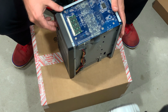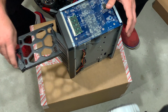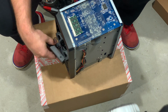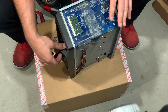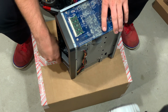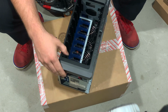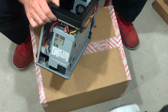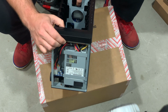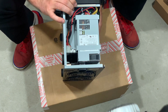What they don't tell you on the spec is that inside of the box here, there's another SODIMM slot that you can easily access. So if you look right in here, there's a slot right there, and right now it is, how much is in there? This is the 2 gigs of RAM in here. We're going to take this out and put this in the other unit I'm sending back to Synology. Pretty nifty, huh? Hard to see though.